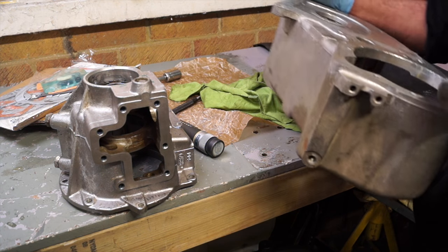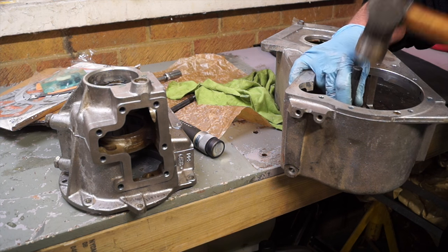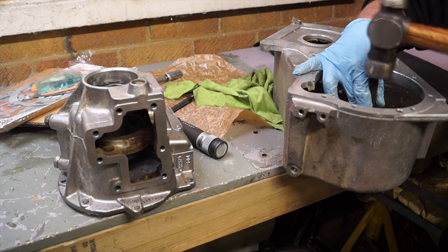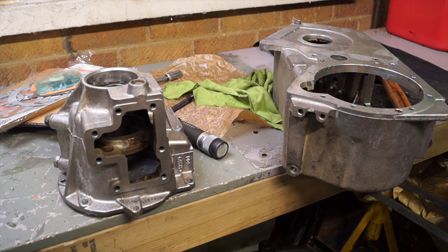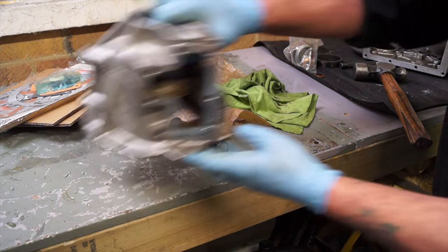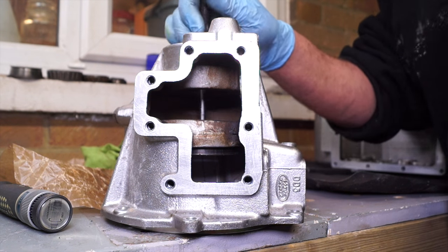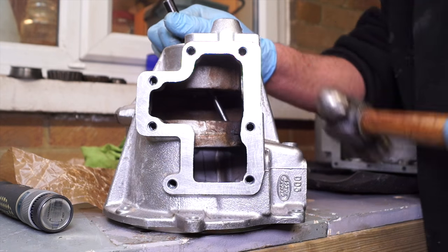If you're anything like me, you might be forgetful. So what I do is leave the bearing races in the case until I'm ready to recover them, then I can identify them and fit the right bearings in the right places. The two bearings on this diff carrier and gear carrier are different sizes. So I'll take the one out of the casing — which will be to the rear housing. I'll keep that so I know which side it goes onto.